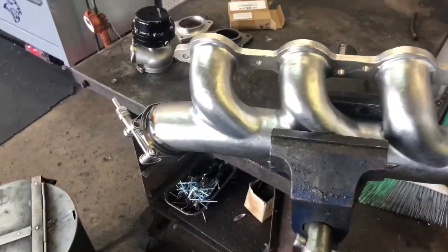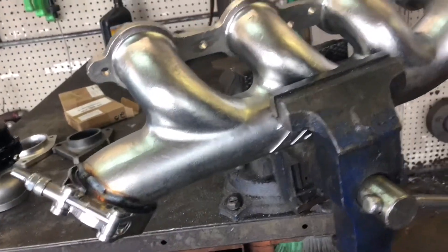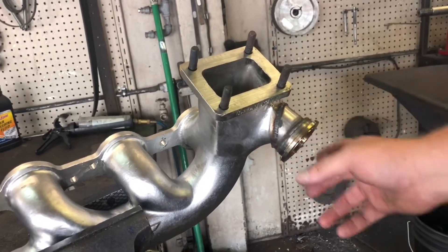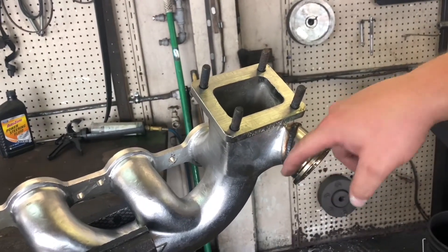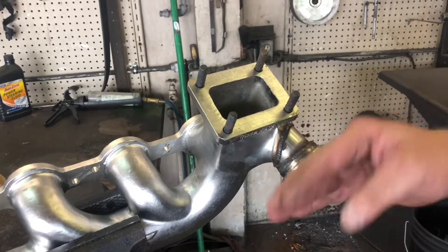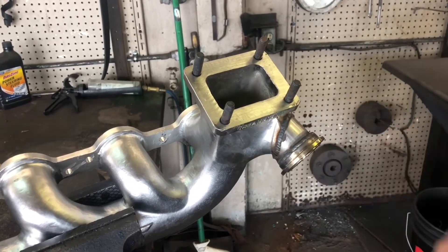All right, so we've got the V-band on here, and now we're going to cut this V-band back off — we misplaced it by accident. We thought that we could kind of avoid everything and go down, but it actually put it right into our inner fender. So we're going to cut this off because we still need this V-band, and we're going to cut it right here and just bend the pipe up, get it kind of beside the turbo and off the inner fender, and we'll just make it work.